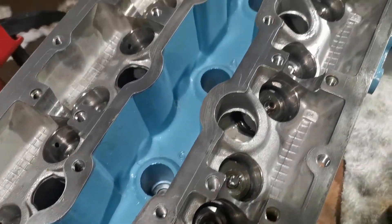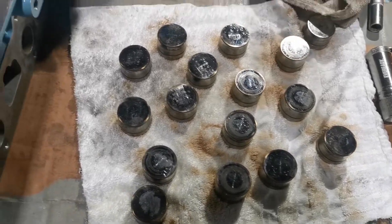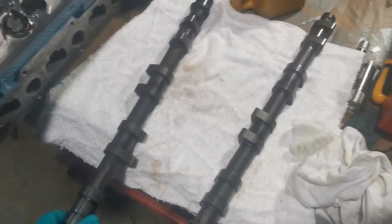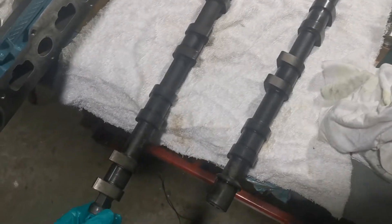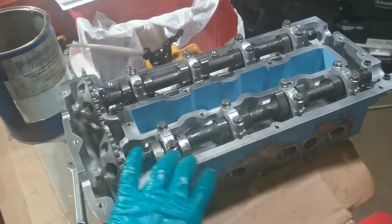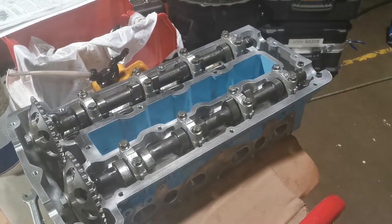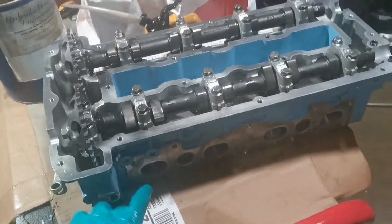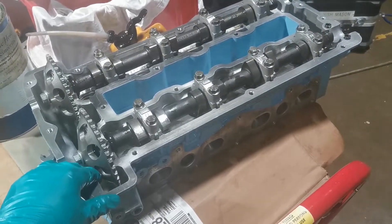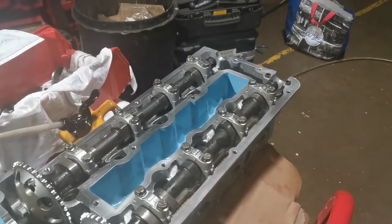So I've fitted all the springs now to the top block. I'll just go over and fit these cam followers but they're looking a little bit worse for wear so I'm going to polish them up a bit and then fit them in. I've fitted the hydraulic cam followers as you can see here and now I'm going to put the camshafts in. I'll do this off camera and I think that's as far as I'm going to go for tonight. I've tightened all the bearing caps and tightened all the sprockets up and torqued them off as well. I can still do a little bit more like put the exhaust repair kit in, but I'll probably do that off video. Thanks for watching guys, stay tuned for the next video!